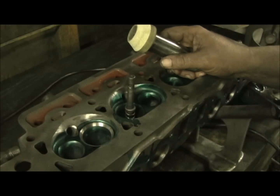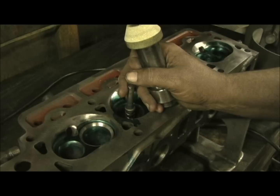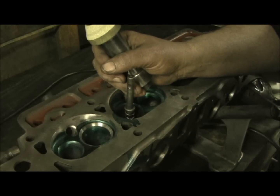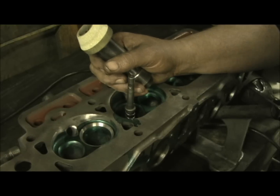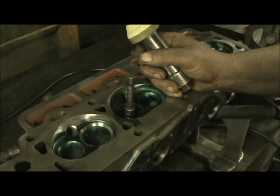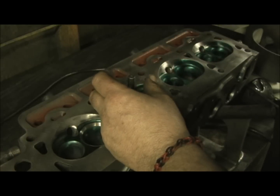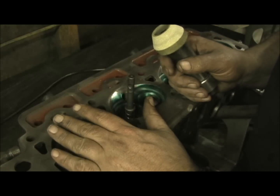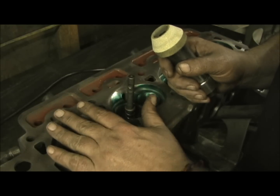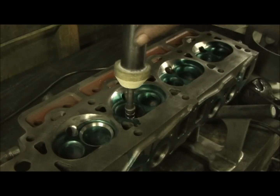What I'm so happy about right now is I got these valve guides. Every once in a while you get some that are super, super straight, like the Ford FE heads I did. Those are hands down the best guides I've put in in quite some time, and a lot of that is just luck of the draw. But these came in damn near as good as the Ford FE valves. When I installed the guides, I'm really good with my hands at positioning the driver that reams and cuts. Plus the guides were not totally wore out. If you get a head where the guides are just a little bit wore and not totally wore out, you're going to do a better guide and valve job installation. The worse wore out they are, the harder you're going to have to fight to make it come in. But this one came in perfect.